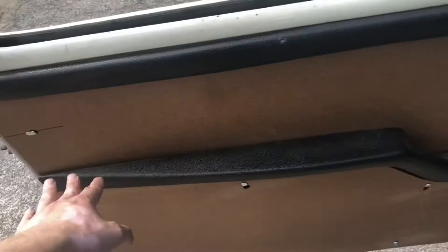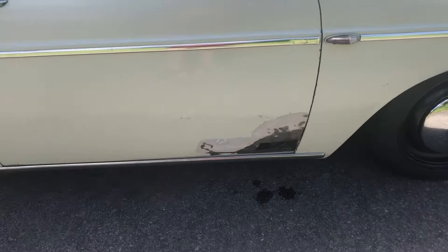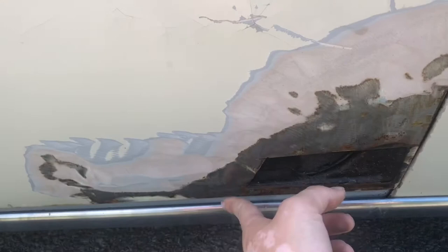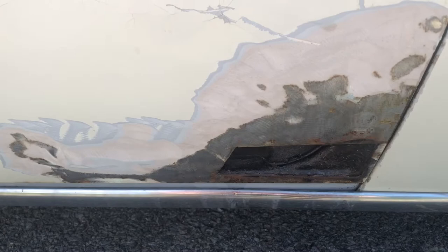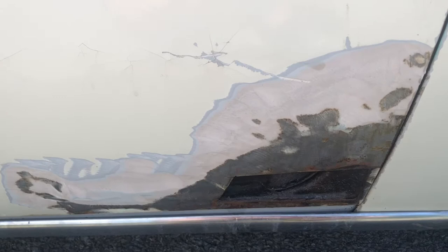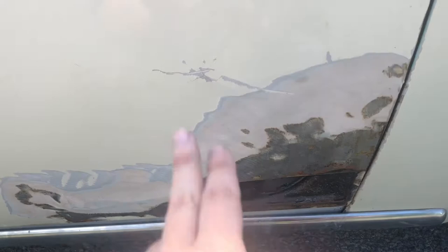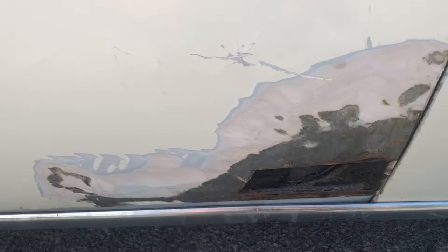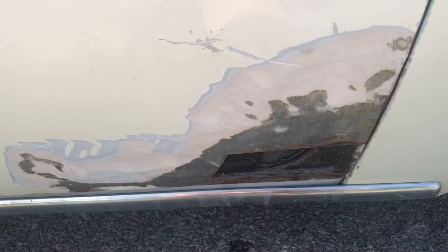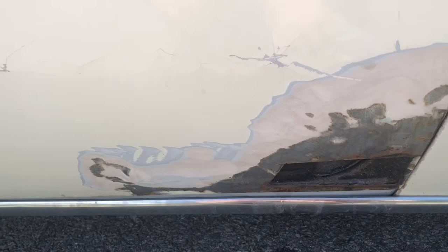We have the correct Z-style armrest. This door does have some cracked filler, and the previous owner had gone ahead and cut out some rust. For me, I'm going to take the time to sandblast that, corrosion protect it, and put a new patch on there. Before I take the whole car apart for paint and body, I want to drive it and enjoy it. I am finishing up a 66 Fastback — first year Volkswagen Fastback. But I have some L87 paint from the roof and bumpers of my square back, so I can blend it in for the time being and make it a little more presentable until I'm ready to strip it down and do a better job on metal work.